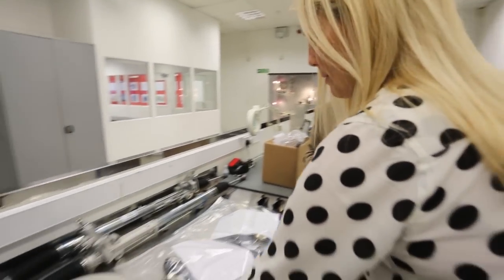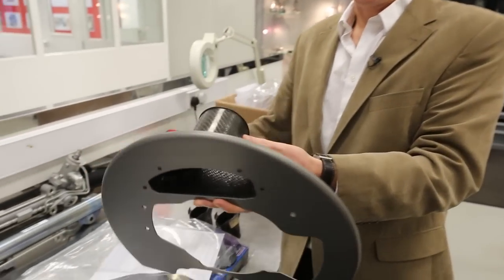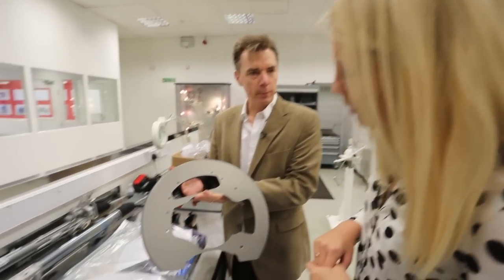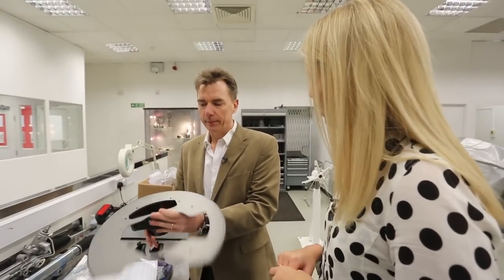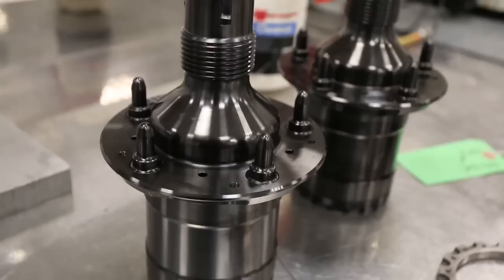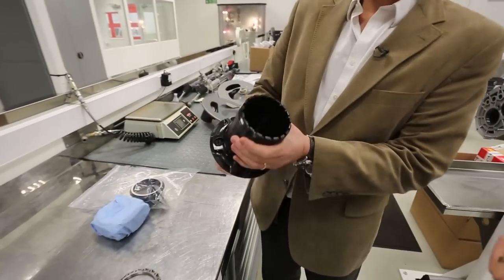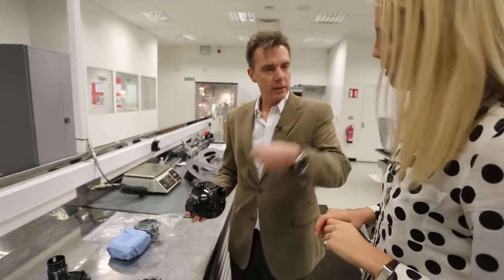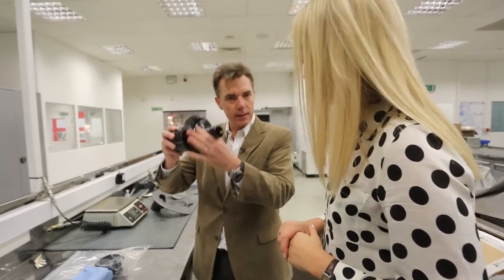This component here is very, very light — it's a backing plate on the brakes, not the brakes themselves. It's part of the front upright assembly and has a venting duct that helps cool the brakes. Obviously you want to keep the brakes as cool as possible to be as efficient as possible under heavy braking — especially when you've got to run for 24 hours. Down the end we've got a few extras: this is all part of the front upright assembly. In the middle you can see where the single nut goes that holds the wheel, with lugs to position the wheel, and the wheel bearing goes around there as well — all spinning in the centre of the upright.